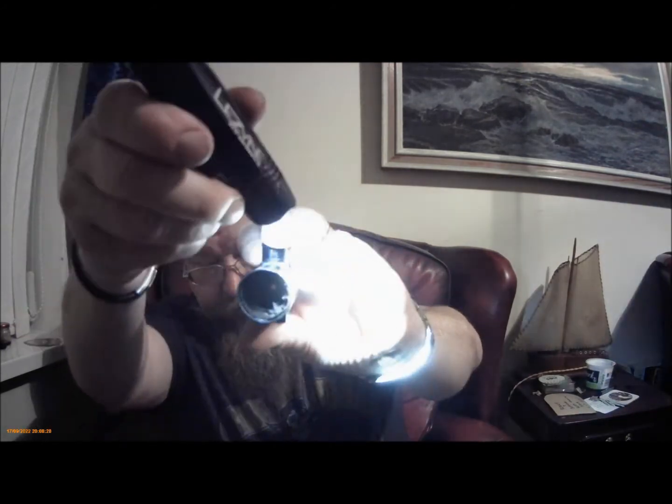But what also has been destroyed, and not by me, let's see if you can see this. There should be magnets lining the outside, of which there are still a few there, but there's also a few in pieces because they've rusted up, and when I managed to get the armature out, the magnets or pieces of magnets have come with it. So basically the motor isn't serviceable. You've got to destroy it to get it apart. Right.